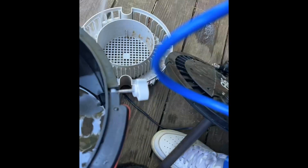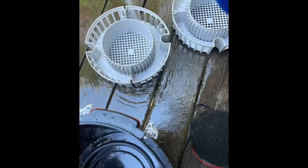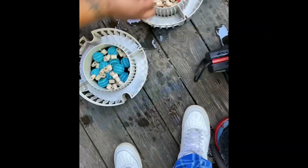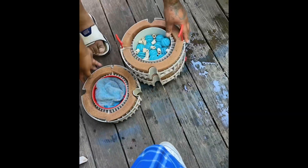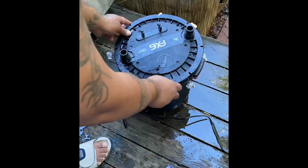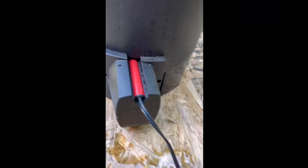I do use the hose to clean off all the plastic parts — it's not a big deal as long as I don't get any hose water on the sponges or any of the media. Once I put it all back together and plugged it back in, it just didn't start up. So this is when I had to take apart the motor and clean the impeller. It was a bit of a pain holding the camera and the screwdriver at the same time, but I think I did a pretty good job.